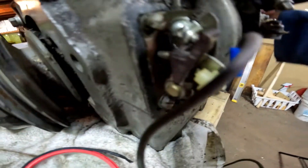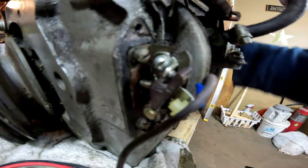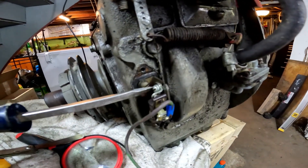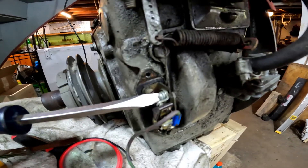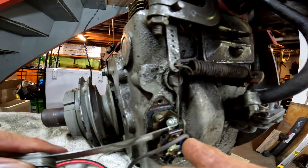Let me get you in there with the points. You keep turning — it's very microscopic, you can see them open and close. You've got to turn your wheel until it gets to the furthest open point. Now it's open, you can see it — furthest open for me would be right here. Unscrew this screw right here. The screw I just removed to adjust the points — if you take it all the way out, that's what I sanded right there. That side and the back of the points. That one screw right there is what I took off to sand the back of that — that wasn't making contact with the block to short the engine, to break the negative.